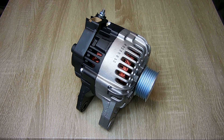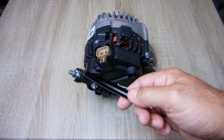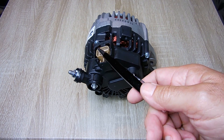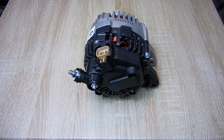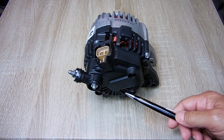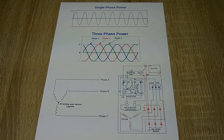Over here is the charging output from the stator — this gets connected to your battery. Right over here is the harness connected to the internal voltage regulator. Inside these openings are your rectifier diodes. They take the AC output from the stator and convert it to direct current. When I open up the unit, you're going to observe that the stator has three sets of windings because it's a three-phase output, and that's what alternators use.